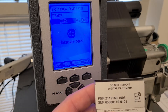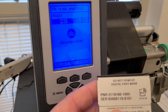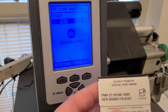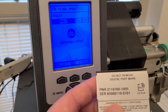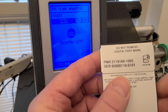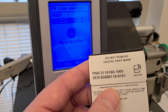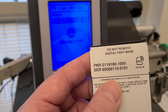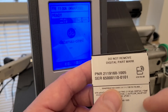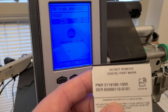It's better to make these adjustments on the printer itself. These adjustments are due to mechanical tolerances in each printer. In other words, you can send a certain design to printer one and it may be perfect, but printer two, using the exact same software and exact same template, may be off. So it's best to do vertical and left-right centering adjustments on each individual printer.